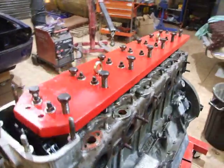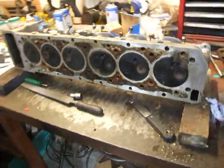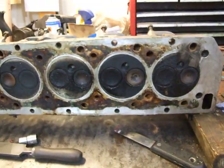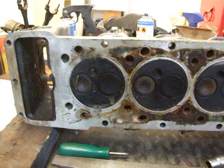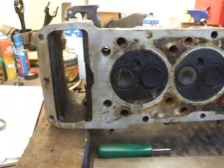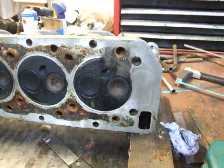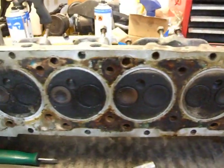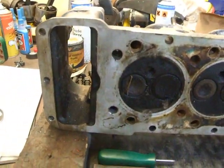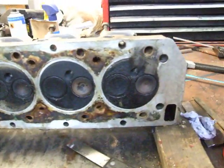What I'm going to do is show you how good this machine really is by showing you the head that we've already taken off. This head here has been on here for about 35 years, and when we took it off there was no damage whatsoever. Anybody that's stripped an engine before will tell you that if you're stripping an aluminium block with aluminium heads and you use fox wedges, you're bound to break something or mash something up. But with this little machine, there is no damage on the mating face at all.